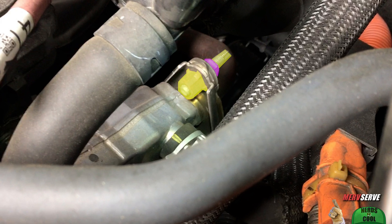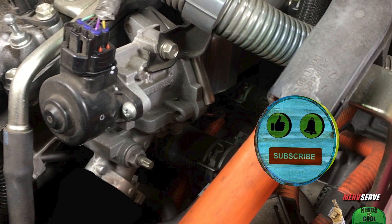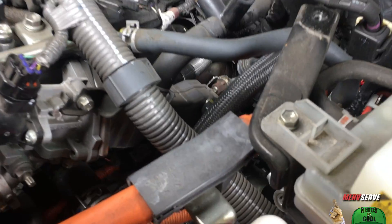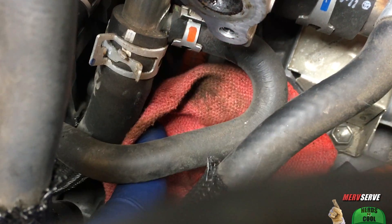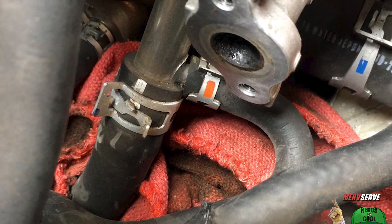From front to back, stem to stern, there's only six mounting points and four hoses that need to be dealt with once that little pipe's been taken off like I already done in that other video. The concept is simple, but that don't mean it's going to be easy. So looking down in here, you see the front two hoses — they need to be pinched so coolant won't leak everywhere. Same with these two back here, which you can see are nestled within a tangle of obstructions. The case can be made that not every coolant hose needs to be pinched off, but I hate the greasy spillage, so tucking some rags in key places is also smart. Here's an important secret: if you was to pinch clamp your hoses first, the handles of them pinch clamps can actually get in your way later because the space is tight in here.